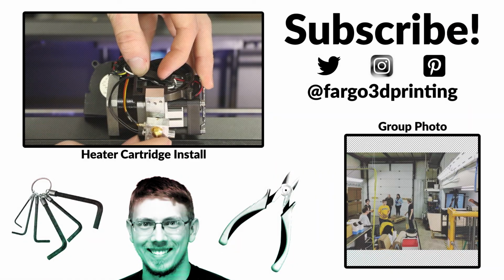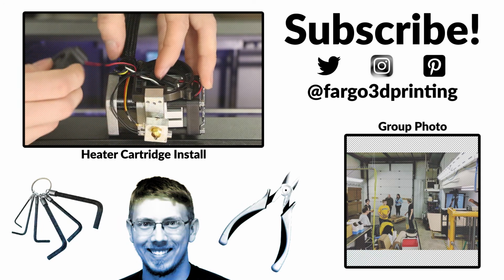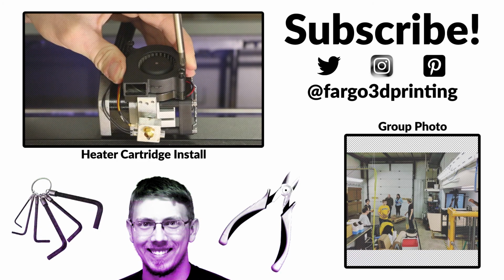Insert the new cartridge into the heater block. Replace the active cooling fan on its mount. Make sure to run its wire through the same opening you ran the heater cartridge wire through. Tighten with the Phillips screwdriver. Reset.